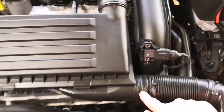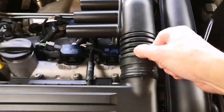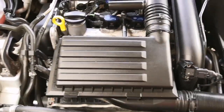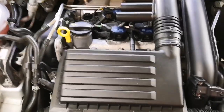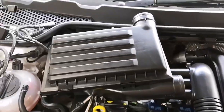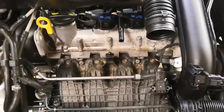With a pair of big mole grips I've managed to move this bracket here to the side, and this bracket here a little bit up, so it should free up the air valve. I need to lift this up out of place because it pops in with three poppers, and that should allow me to take out the air filter box.